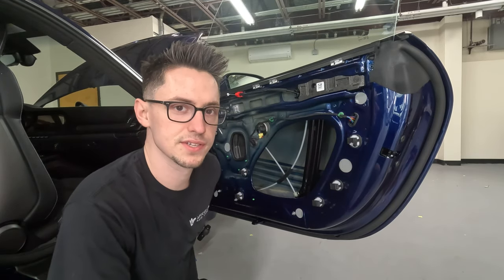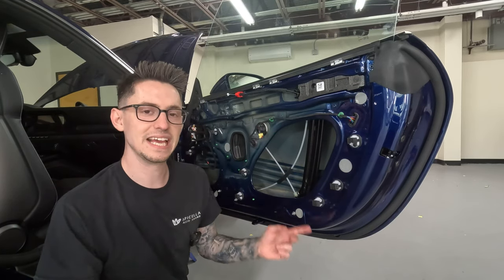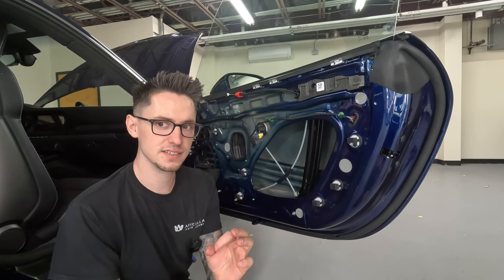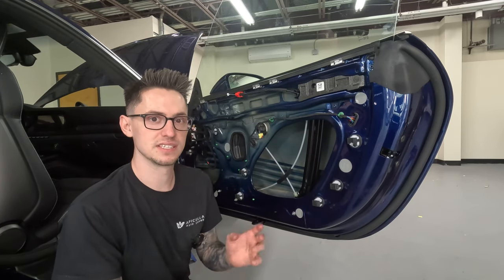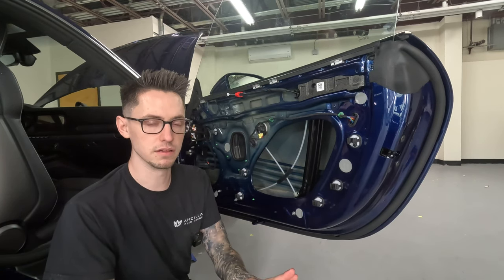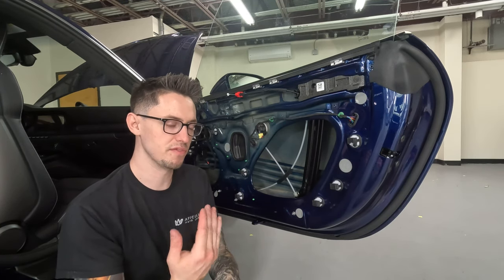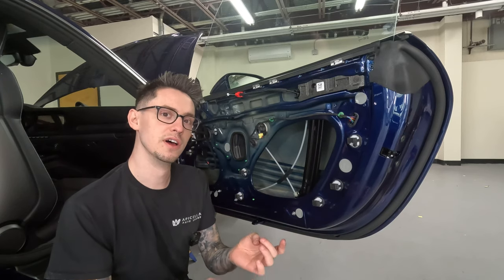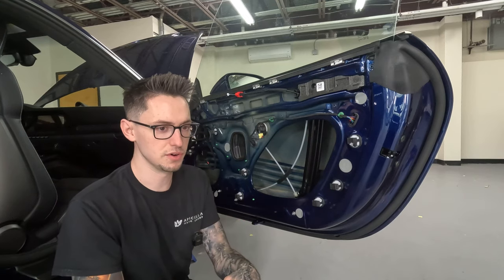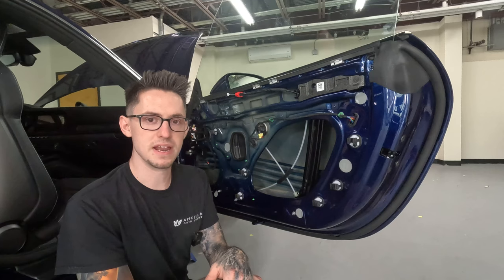A few tips for those who have never done this before. Use as large of single pieces as possible. Doing a bunch of tiny pieces, even if they equal the same size or same coverage as a larger piece, is not nearly as effective. Remember, that layer of aluminum is providing a reference for the butyl to provide shear forces against. When we cut that reference layer and cut that butyl, that reference layer and those shear resistance forces diminish greatly.